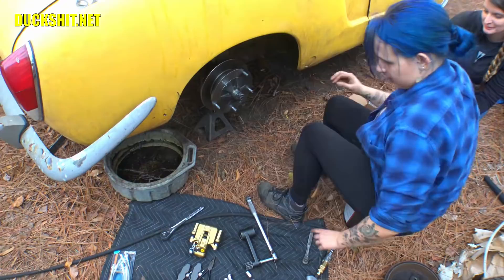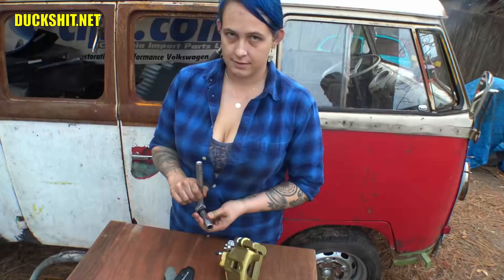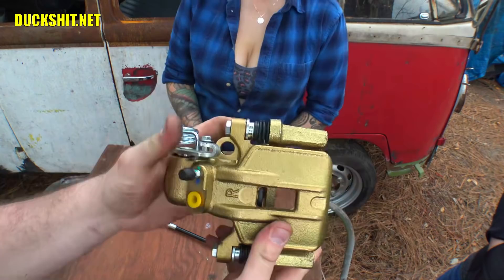Remember what's next? Caliper. The caliper goes on — but first you've got to open the bolts and drop the pads in place. We'll do it over on the bench. B's got herself a wrench and a caliper. It has an R on it — that does indicate it's the right-hand side. There actually is a polarity to these; one doesn't belong on one side versus the other, and the difference is where the spring goes. These are on the top. Some old ones used to be on the bottom, where brake cables would run along the bottom of the vehicle and road debris would smash them. This design runs it up and over the top of the trailing arm, putting it in a safer spot.